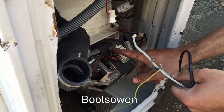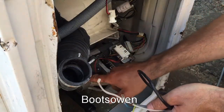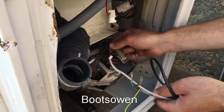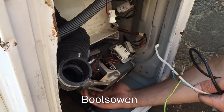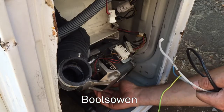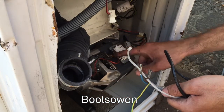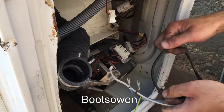Now looking at this arrangement, we've got seven wires. We've got two red ones going to the tachograph — or tachometer — down here. There's one that's almost white but filthy, going to this brush here. And on the other side, there should be another brush with another wire. So on that basis, I suspect the two on the top go to the brushes and the three on the bottom go to various windings.